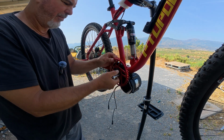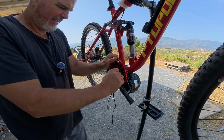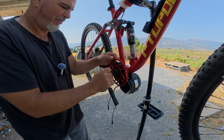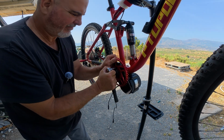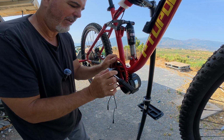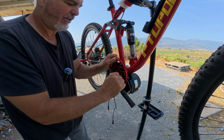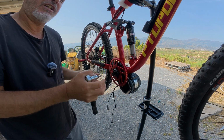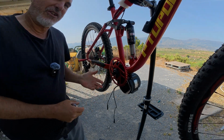Okay, I'm going to gradually tweak these up, going opposite bolts crossways. I don't think it really makes a lot of difference, but just old habits when bolting circular things on with bolts. Careful not to over tighten them. That's why I'm using a small wrench rather than the big wrench, and I'm actually holding it here rather than on the end of the handle, just to make sure I don't get too much pressure on these little Allen bolts and snap them. Okay, that's good enough for now. Obviously we're going to need a few rides on this bike, and then everything will need checking and tweaking up. Okay, nice easy job for the start of the day.